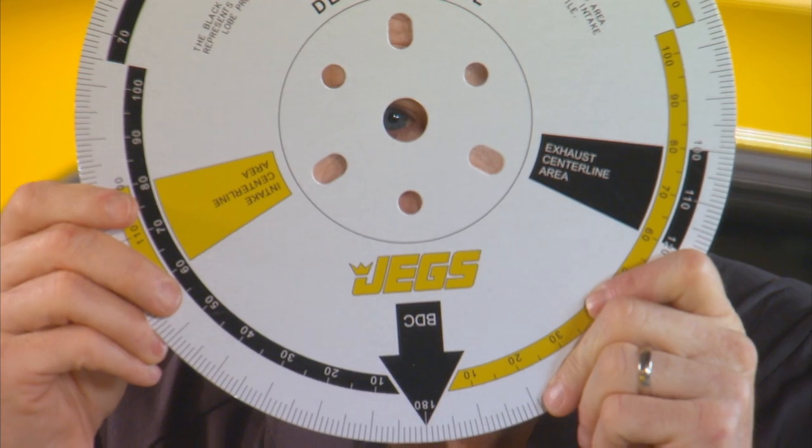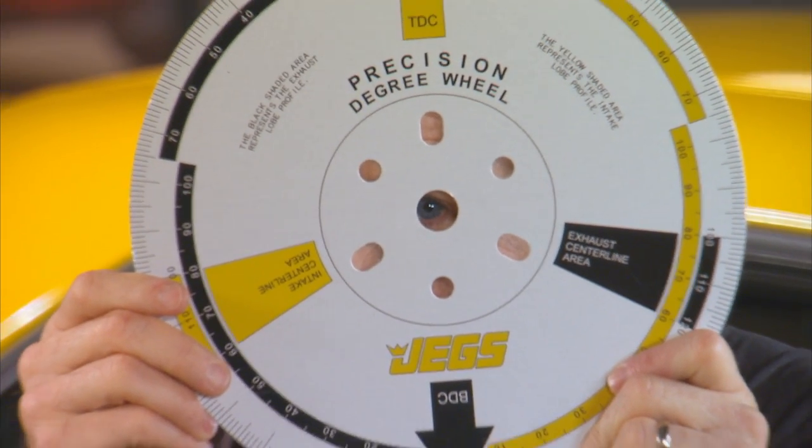There's a precise 1.000-inch dial indicator with thousandths of an inch gradations and a 5.000-inch dial indicator extension. The Cam Degree Wheel has bushings and a washer for mounting, and the Lobe Checking Fixture will bolt to blocks with seven-sixteenths or half-inch head bolt holes, or cylinder heads with quarter or five-sixteenth-inch valve cover bolt holes.